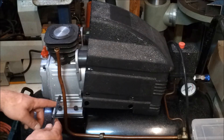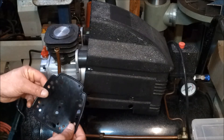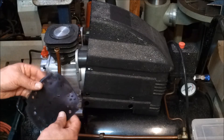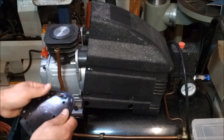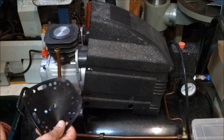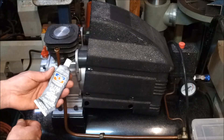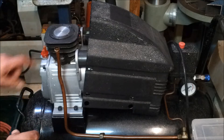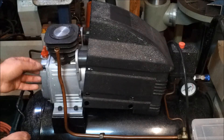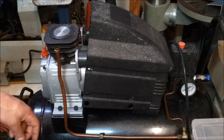I did try to use the old gasket and it started leaking oil from a few spots, so I had to take it all apart again and clean it out. I then added a few more holes to the gasket thinking that would help it stretch out and make up that three or four millimetres, but that didn't work. So I resorted to using some Permatex UltraGrey, which is a rigid high-torque silicone gasket maker. I went metal on metal, applied the silicone all the way around the joint, bolted it together, waited half an hour, then added a quarter turn to each bolt — and that seems to be holding up fine.